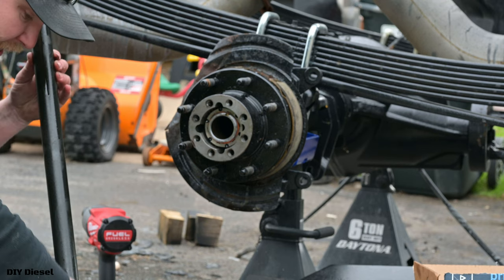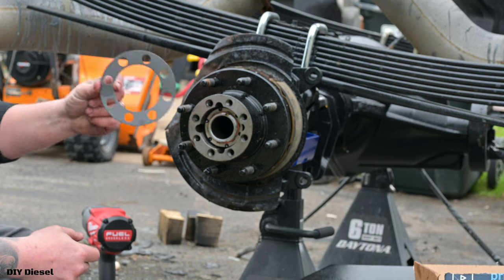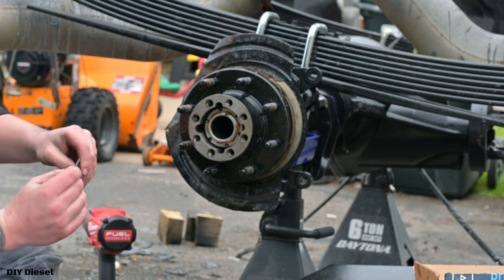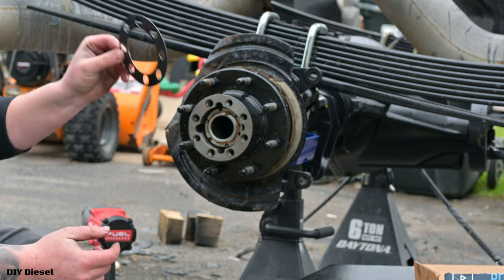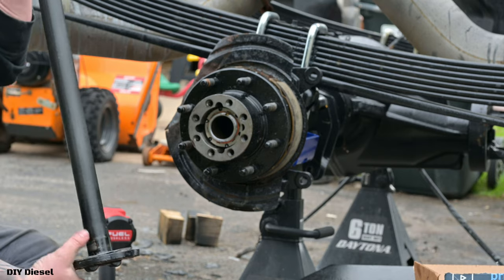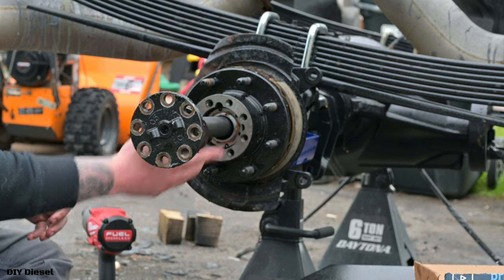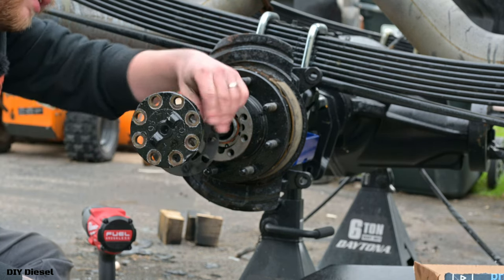Now, of course, we're gonna go ahead and wipe it down. Here is the gasket, and you need to be using a metal Felpro gasket. I do believe Mahle makes one too. Highly suggest using this. Fits right over like this. I'll link all the stuff below for you guys. Slide it on, just like that. I'm gonna go ahead and set this in for right now, and I'm gonna finish cleaning the end of this, because there's a lot of gasket maker on it.